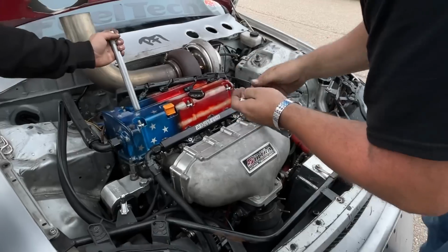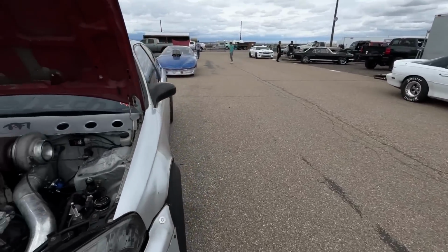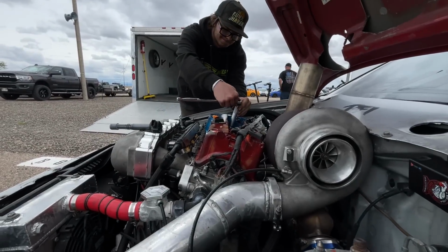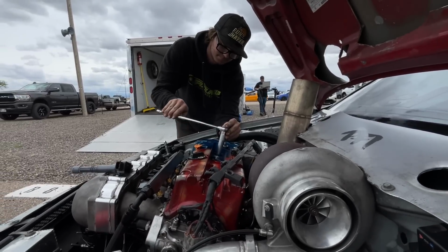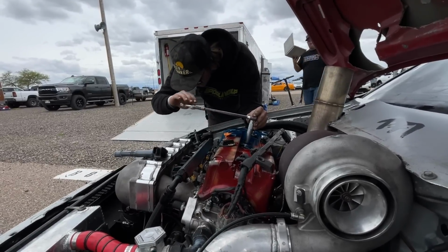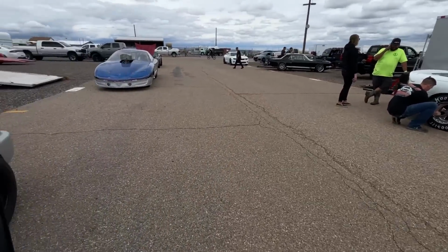Yep. We went and bought brand new coils. Thought we had it figured out. Thought maybe that would do it. Turn the dwell way down. So it did for one pass. Well, it seemed to do it when it's cold. Cold, it'll two-step no problem. But when it's warm, it does this. And it does seem to be a temp-based deal.